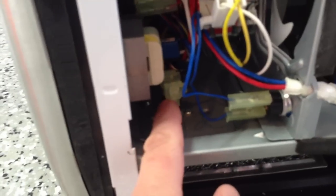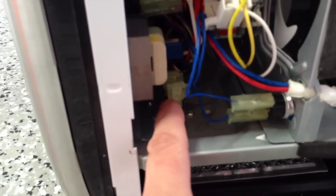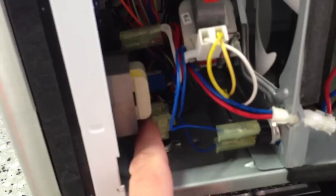This is really important — listen to this step especially. You have to disconnect this connector completely and then just let it sit there for 15-20 seconds, completely disconnected. Then I went ahead and did the back one as well — I'm not sure if you have to do the back one, but I did. Remove both completely and then reconnect them; you'll feel them click into place.